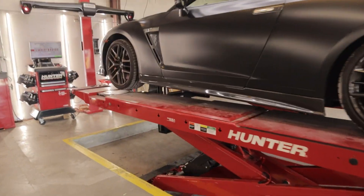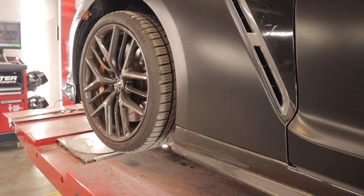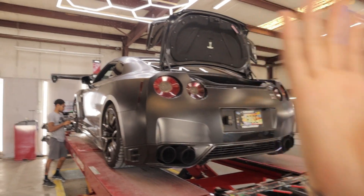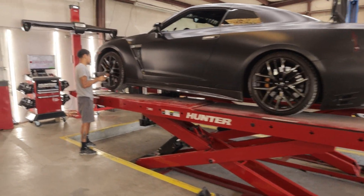We are in Orlando right now. We have a few errands here. Number one stop is to figure out if we can find the leak in this bag. And then two, we have to deal with some title work for the race car. And last but not least, we have to pick up the race car in Daytona on the way home from Orlando — so a long to-do list today. Hopefully they can knock out this air suspension issue and we can get our title locked in. We found out there was nothing wrong with the bag — just the airline. It turned out to be one of the lines in the trunk that shifted when we did a pull because the whole management slid back and unplugged one of the lines a little bit. So that's all fixed, and it had nothing to do with the bag at all. The car is fine. Let's go get our race car back.